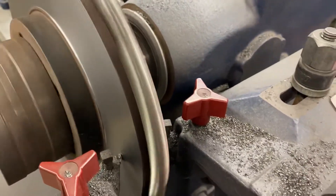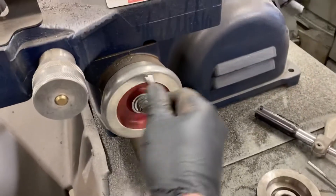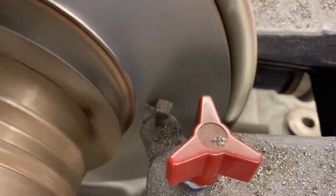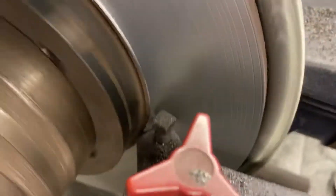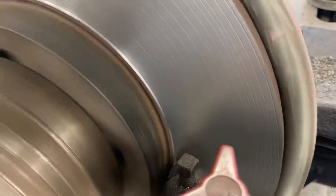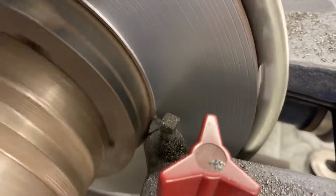I'm going to bring that all the way in, watching out at the end. I'm turning this knob right here, but I have to watch this as I get close to what they call the hat of the rotor to make sure I don't hit that. I need to slow down right when I get to the end of this area where the pads rub. Okay, so that's good right there.